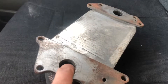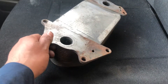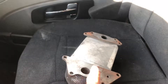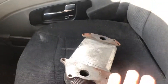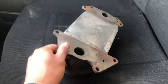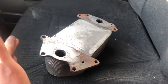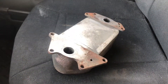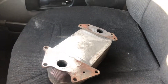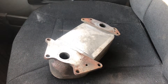Remember, this part is completely submerged in coolant and these holes are where the oil passes through. This is how your oil cooler works — specifically for DD15, DD13, and DD16 engines, but in general all oil coolers work like this. The job is the same: to cool your oil while your truck is running. Thanks for watching — let me know if you have any questions in the comments below, and if I forget something I'll leave a note in the description.